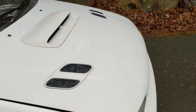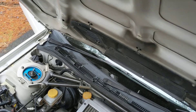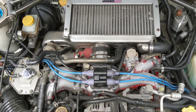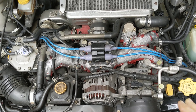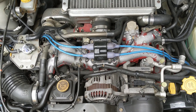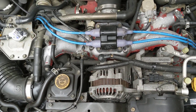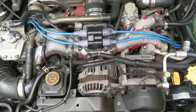Let's take a look under the hood. I spent a lot of time under here in the last month getting things ready. Some other changes from the Version 1 and 2 — this is the first Subaru engine with a Subaru Turbo to carry an open deck block. The EJ20G that preceded this engine was a closed deck. Subaru tried to improve cooling so they opened up the deck of the block. This is the same type of block that all modern STIs use. On this particular engine you can see the remnants of the red manifold — the paint comes off all of these. I considered having it redone but preferred not to spend 10 hours and $500 doing that for a car I'm selling.